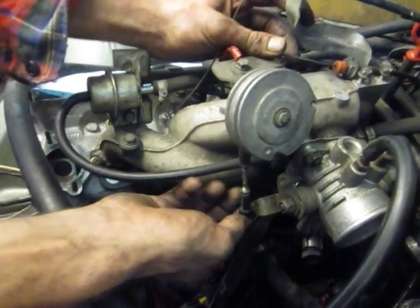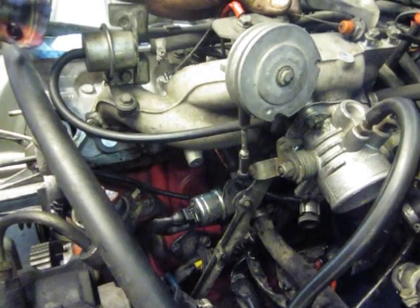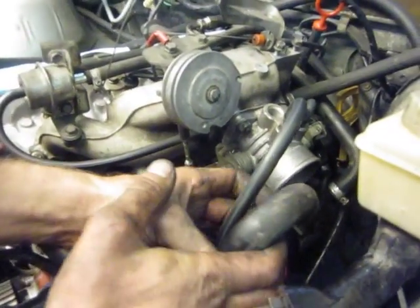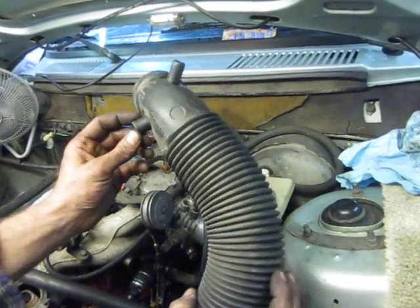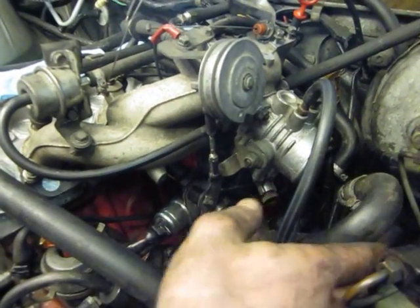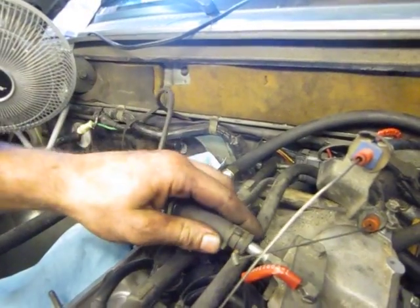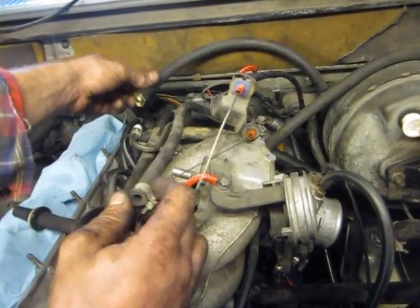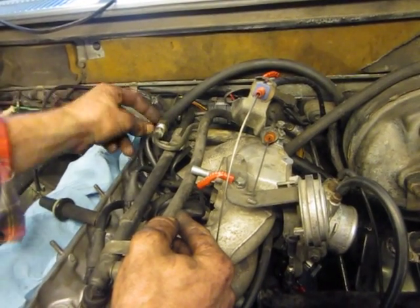Go ahead and connect that bracket back up with these cables, and reconnect this to the throttle lever — remember that little tab. This pipe is the other side of the ducting — this bigger vent goes to your air control valve, go ahead and hook that up. You're going to want to go to the cold start valve — this little regulator — it's going to go in. And of course your fuel lines — go ahead and reconnect your fuel lines from the line pressure regulator and your line in on your fuel rail.